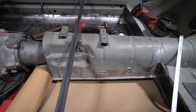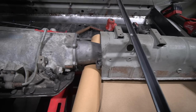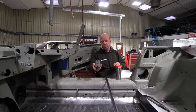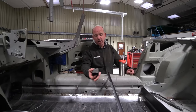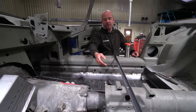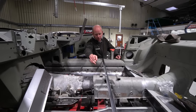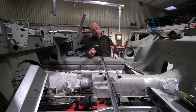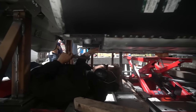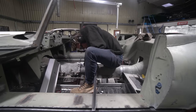He picked one of the two rubber mountings to trial-fit — that bolts onto the gearbox and will fit into the underside of the tunnel. He's going to fabricate a small mounting that transfers the force from that onto the shoulders of the transmission tunnel. Before he does that he's got to put a new base in that section of the transmission tunnel, so his current unpleasant job is grinding out all the spot welds on the underside of that piece of tunnel — laborious and very dirty work.